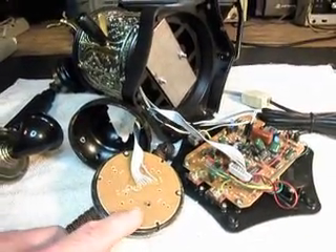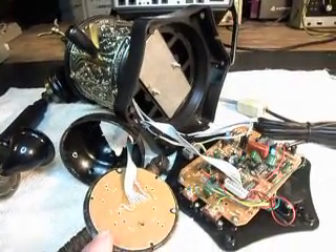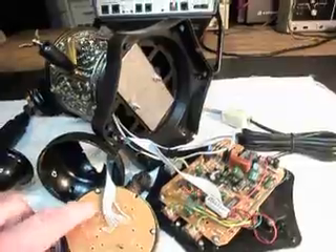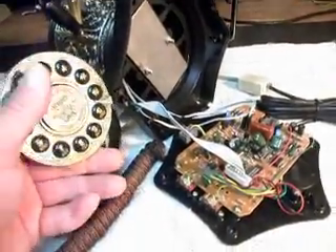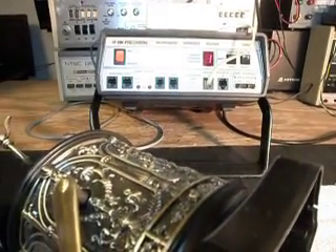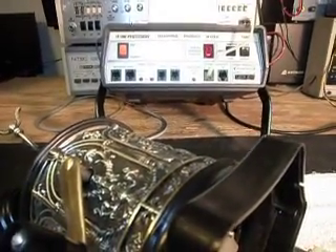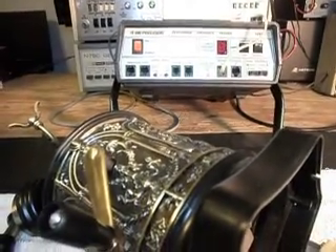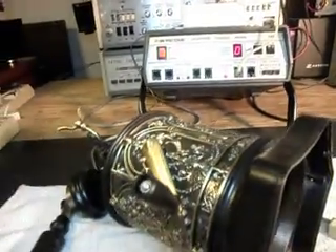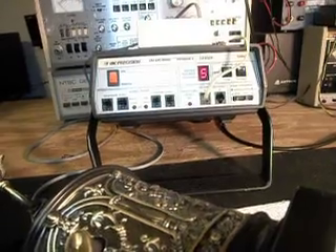I'm going to call this the final checkout video of this telephone. I'm going to let this hot glue dry, then take the board off again and clean the keypad and dial pad. Everything looks good. I'm going to dial 1, 2, 3 — and run through all keys — back to 2. This telephone does not seem to have a flash in the center; some do, some don't. That could be a manufacturing thing where they set it up with redial only. I'm going to hang the phone up, bring back dial tone, and hit redial.